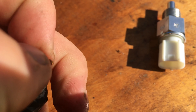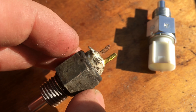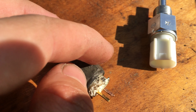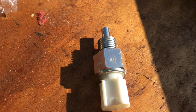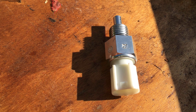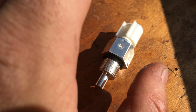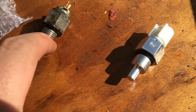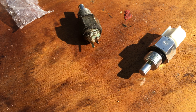This is actually a piece of old brake pipe that I hammered down - I drilled a little hole and pushed it down in there to see if the light would stay out, and the light did stay out. So that was a temporary fix and we drove it around like that for a couple of days because this is my dad's Land Cruiser. But you do need to put in a new one really. Interestingly, when this was broken and getting a partial connection, it also made it much more difficult to engage the gears, and once I put the new pin inside it went into gear a lot easier.